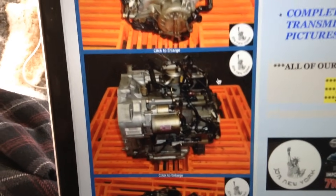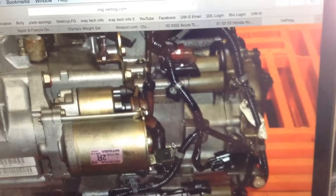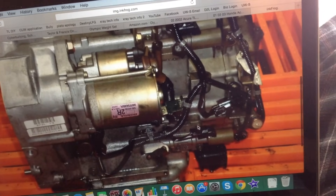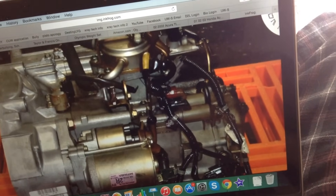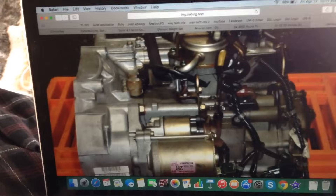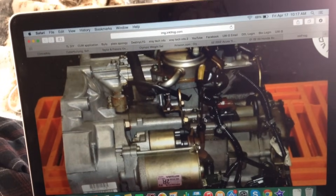Let's take a look at what this looks like on the transmission. If you're standing in front of the vehicle, this would be the driver's side and this would be the passenger side. There's the first one, located kind of on top of the transmission — it's a little bit easier to get to than the bottom one. Neither one is really that hard to get to. They are simply held on by a couple screws — this one has four screws and the other one has six screws. They're all really easy to get off — just pop them loose and then you can remove them by hand.